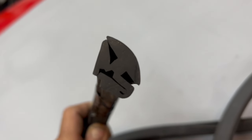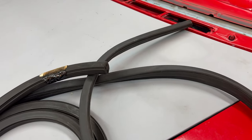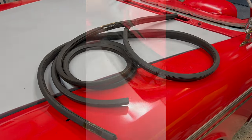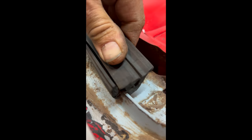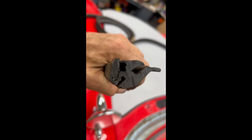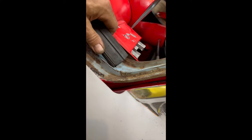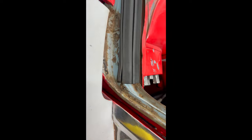It is a nice product as far as design, but it's just not molded. It doesn't make the turns. You have to miter the corners and seal them, but if it could be made to work, I'll make it work. This is the first time I held this to a car. It's on the verge of useless. The profile's wrong, the lip's too high. Even when mitering this, it's gonna look like absolute trash in that corner. No go on this repop stuff.